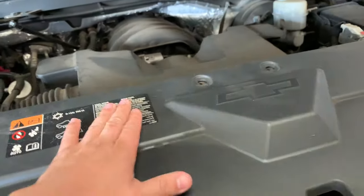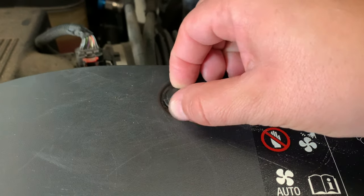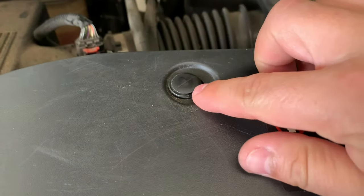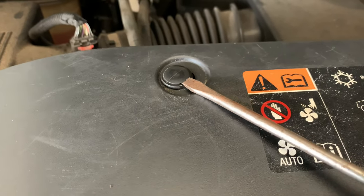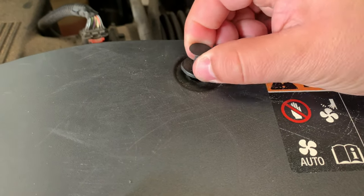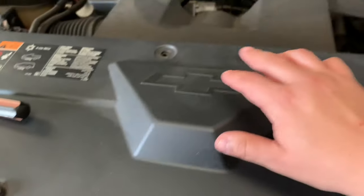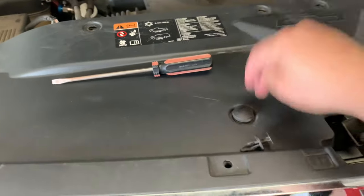For starters, I'm going to take off this plastic cover here, which I already started removing. This plastic cover is held on by these little clips. The clips go inside like that, and to remove them you just have to turn it until you find the actual tab. Put it right there on the tab, then turn it a little bit — once it pops, pull the whole thing out. It has one here, one there, one there, one here — once all those are off, we can remove the cover and get it out of the way.